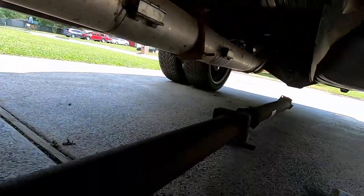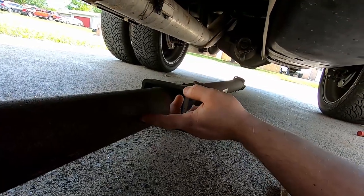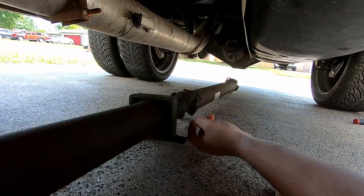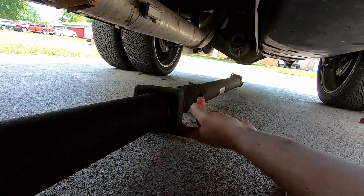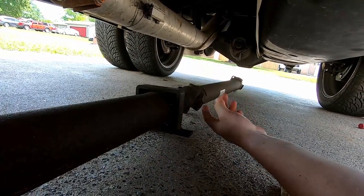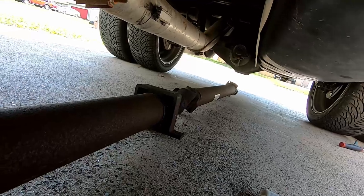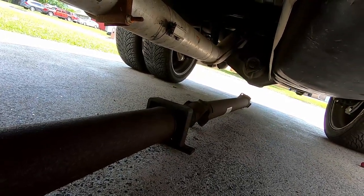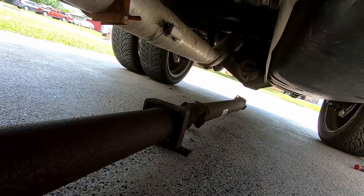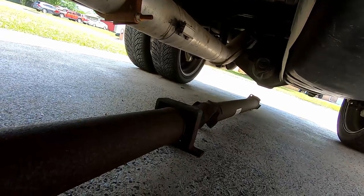There's the crappy Dodge two-piece driveshaft. If you're familiar with these, they introduce a problem down the road — if that carrier bearing goes out, you can end up with some pretty major vibrations inside the cab. What a lot of people in the performance world do is ditch the two-piece and put in a solid one-piece — steel or aluminum depending on your application. If I had an extra thousand dollars laying around, I'd definitely put one in this truck, especially being a long-bed dually. That's the last thing I want breaking.